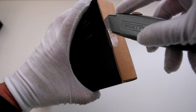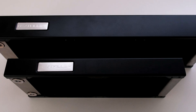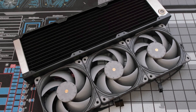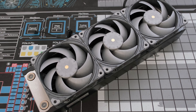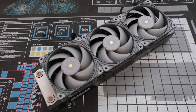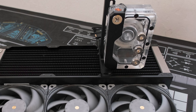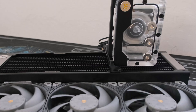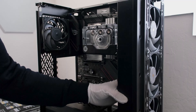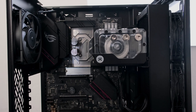We will be using two radiators from HeatKiller's RAD series. First, the black 360L radiator has a thickness of 48mm, and we are using three of Phanteks T30s, as we have enough room in the front of the case to accommodate the fan's 30mm thickness. The EK Quantum Kinetic FLT80 is a D5 pump reservoir combo unit, and is mounted directly to the radiator. The HeatKiller RAD and the T30s fit inside the front of the Fractal Meshify 2 compact case.